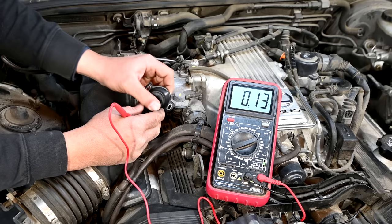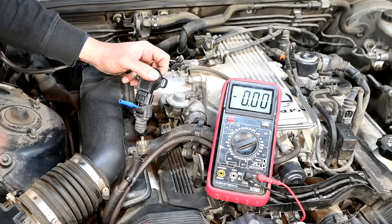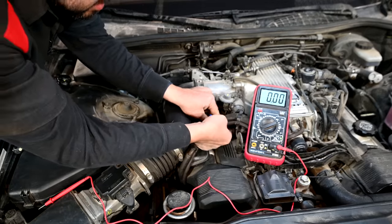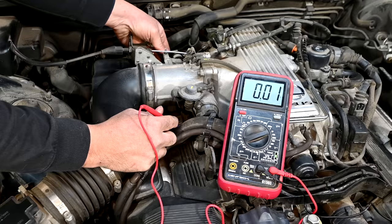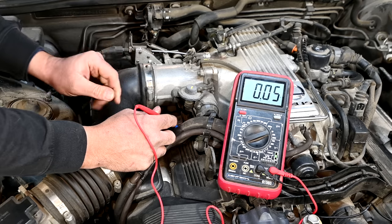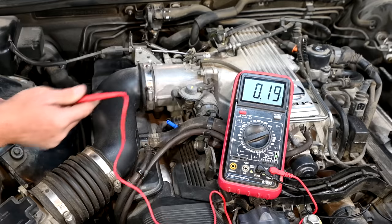I cannot make this be anything besides zero or 12 volts. So this new sensor is good. Just to show you again, we'll put the connector back on the old sensor and do the same thing, slowly opening the throttle. See — I can make it stay at a lower voltage or a higher voltage between zero and 12 volts. I can make it stay at 4.8, 4.9 volts. Yeah, this shouldn't be working like that — it should be just an on-off switch. We have a proper diagnosis of the throttle position sensor.